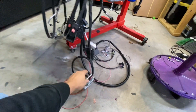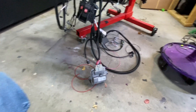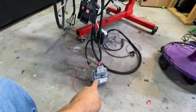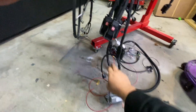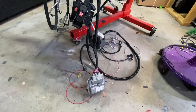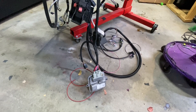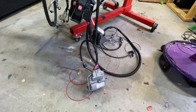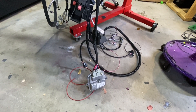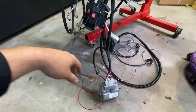This harness has pretty much everything I can think of. We got your fuel pressure control module for the PWM fuel system. This is the power output for a separate fuel pump harness. It's going to have four wires: your fuel pump power and ground, and your fuel level. I'll make that custom link to the Firebird.